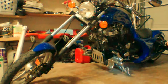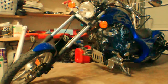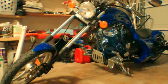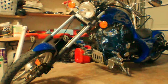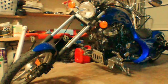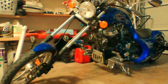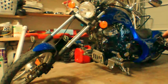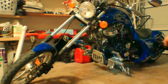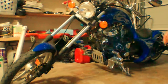Take out the packing oil and put in some new oil, and break in the engine all the way to 100 miles. Very important to follow the instructions. The battery that came with it is horrible. It sucks. It's not good. It boiled down on me after 2 days. I went over to a battery supply and bought a new one for $75. It's been over a month already, and I've been driving pretty well with it.